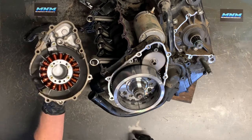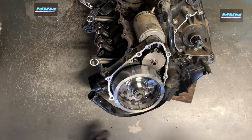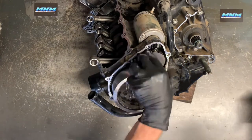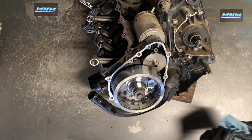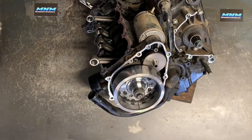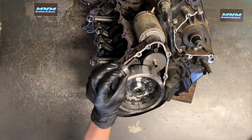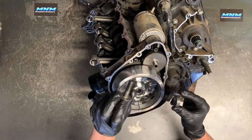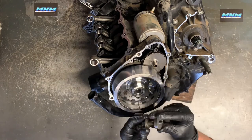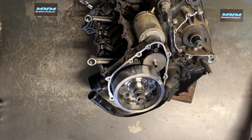The stator looks good — we'll test that. There's a little bit of dings but nothing major; for the most part that coil is complete and with no issues. We've got our flywheel here, our starter drive back here, and our starter motor right here. I'm going to pull this flywheel — that'll allow us to get into the starter drive a bit easier. You do need a special puller for this flywheel; I'll put a link below. There's a 14 millimeter bolt to remove this — just regular threads — and a spacer, so make sure that spacer is included when going back together.